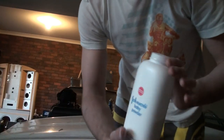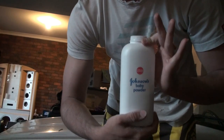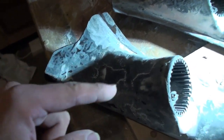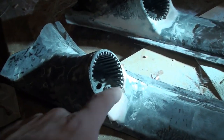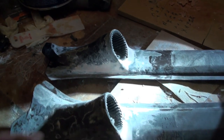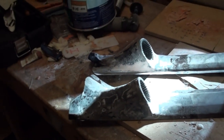I'm covering myself in baby powder because we're about to start sanding fiberglass — and if you don't do that, you will be very itchy. So there we go, that's sanded the glass down. That was the one that had the blobs in it — it's all sanded. This one's really good there anyway so I didn't actually sand that one much. I'll do a bit of body filler around the fronts of them, and those notches — the little holes — are actually where you can get a flat blade in and pop out the tweeter. I'll make them look pretty later on, but right now I'm just cutting them out so I know where they are for future reference.